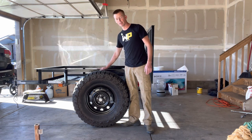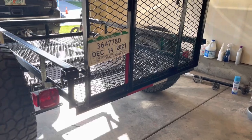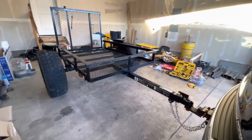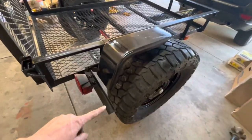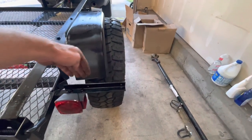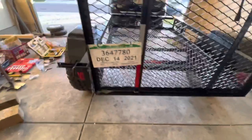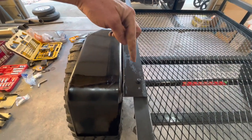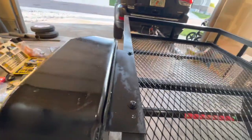All right, so there we are — we got fenders on. We have these outriggers here, and then we cut a piece of aluminum that'll go on the back side to pinch in the cutting board mud flap — I ordered a red one just to break up the color. The fenders used to be a piece of rectangle tube. We cut it 16 inches long, then cut it here and on the opposite side, producing two pieces of angle iron. I left a lip on it, you can see right there, just to give it a little more rigidity.